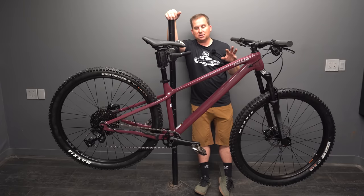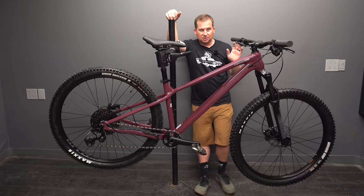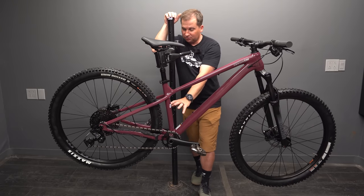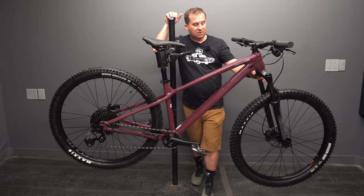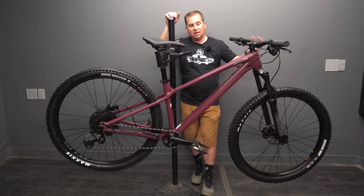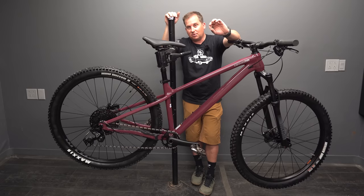I just want to compare this to the Habit 3. The Habit 3 has Shimano brakes, the 200 series brakes. They're not my favorite, but they work. It's got Advent X 10 speeds, same drivetrain there. A little bit lower end wheels. It's got a Suntour fork. If you're going to be replacing the fork anyway, why pay more for the Habit 2 to get a better fork? I feel like this bike deserves to be dressed with really good parts to see what it can do.